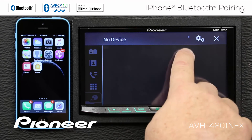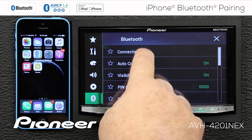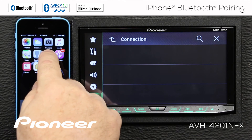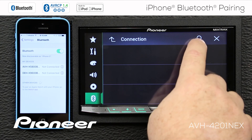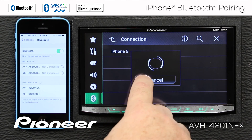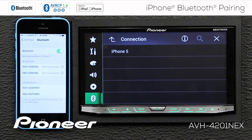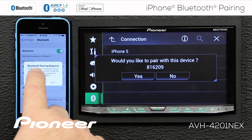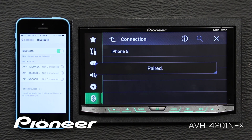When we engage the parking brake, you can see that the gears become available up here. Here is our connection menu — we want to touch connection. Now we want to open the Bluetooth settings on the phone, and when we do that, the phone becomes visible. Now search for devices — here we found the iPhone 5. That generates a pairing request: 816209 — that's the same number here. So we'll say yes on the head unit and pair on the phone, and the two devices are paired.